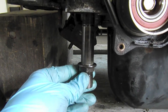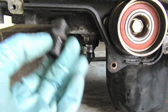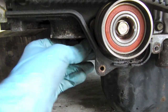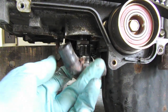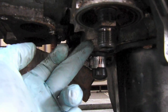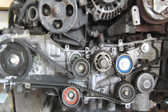Here's a close-up of the oil cooler and oil filter attachment. This setup is way too long if you're eliminating the oil cooler, so you need to get the standard block fitting without the cooler — from a junkyard or dealer — and that'll let you use a standard oil filter. There's also a coolant port that needs to be plugged; the little elbow from the oil cooler just needs to be replaced with a cap, which you can get at a dealer or just plug up. Next up we're going to tackle the timing belt and water pump.